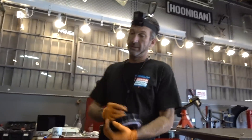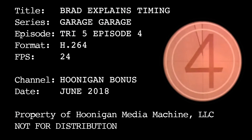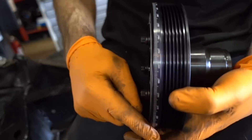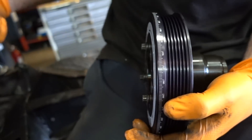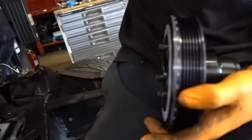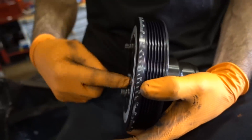LS motors are kind of weird — it bothered me a bit when I built my first one. What's characteristically correct for most motors is that there are numbers on the outside, and people are able to take a timing gun and shoot down to see the timing from the distributor to the crank. That timing reference is top dead center.